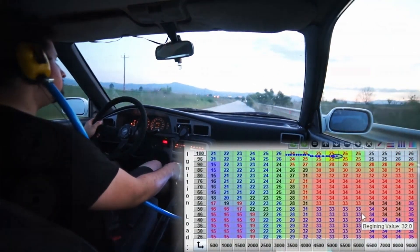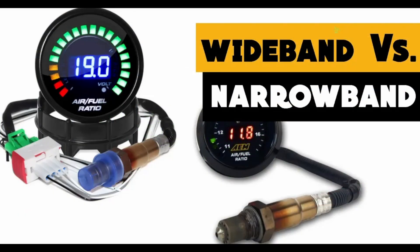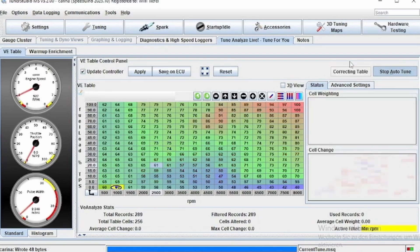For the ECU to work in the car, you really only need a wideband AFR gauge. Without a wideband you are not able to tune fueling correctly. Narrowband gauges cannot be tuned accurately — they can't give readings over or under 14.7 (stoichiometric), which is the ideal air-fuel ratio. They only show a very narrow range, are not very accurate, and are slow to respond. So you should get a wideband gauge even if it's a bit more expensive.